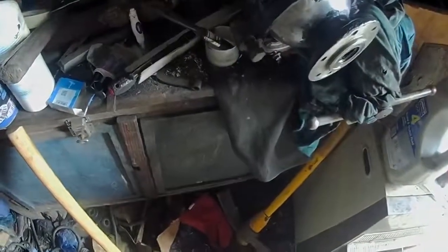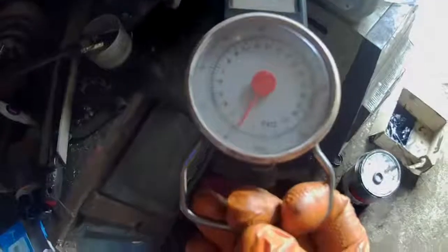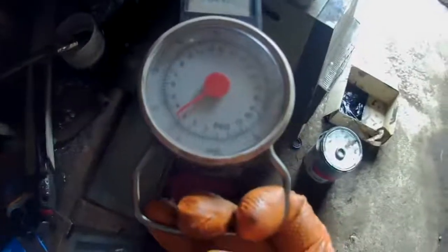Now to give you a clue about how many shims you've got to remove - this teeny little thin shim here is the only one I've taken out. Goodness knows what the thickness of that is - not a lot. It's the thinnest shim that came in the kit anyway. But taking that out means it has gone from a pull of about one and a half kilos. Pulling about three and a half now, which I'm happy with.